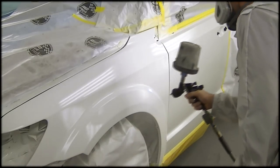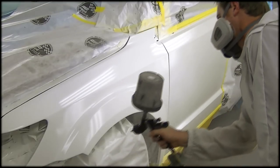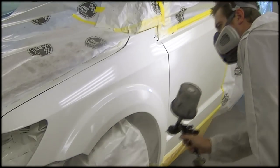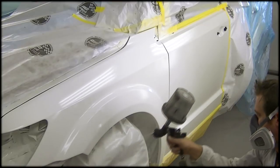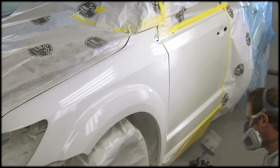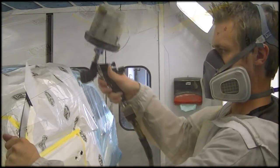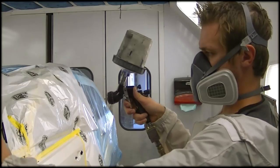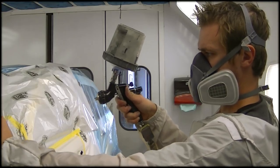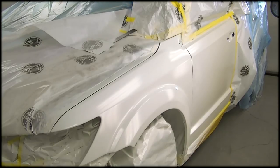And one thing you need to be doing when it comes to three stages is using a hardener in the ground coat, which prevents your mid coat from being able to bite into it and actually altering the color when you apply that in the next step. So here's the spray-out card I was doing, and one piece of advice that is going to be very apparent in a minute: be careful where you put your spray-out card down to dry, or else that can happen. It sucks.